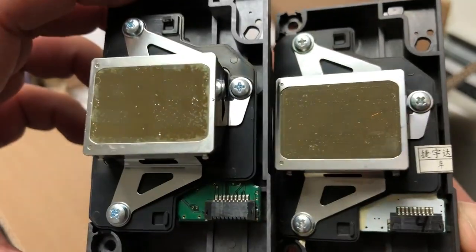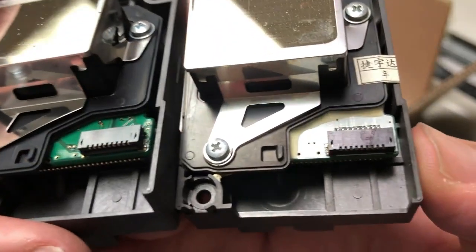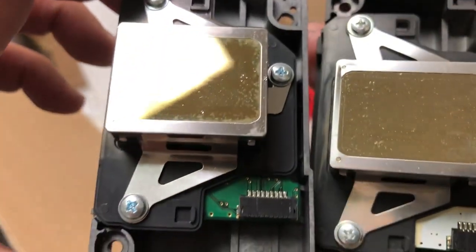If one has the glue, the little yellowish thing you see is the glue. The one on the right - the PCB board is white, so it's not entirely glue; the glue is on the edge. When you see the glue, you know this printhead was previously used for either sublimation, DTF, or DTG, so it's been used pretty heavily.